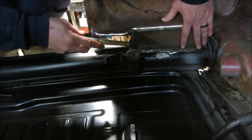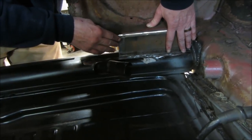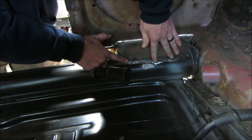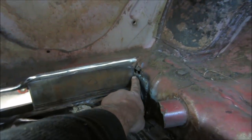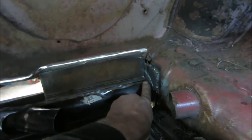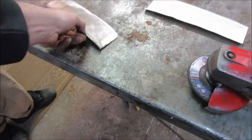Normally we would have folded a corner around that but this will work. Are you hanging up on a weld right there on the top? You're just going to make that a little bit taller and then we're good. I'm going to go grab a corner from basically the middle so that it doesn't walk away on you. I'm going to come back now and about an inch from each end throw another tack now that it's supported.